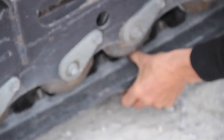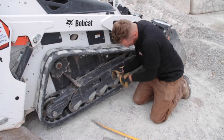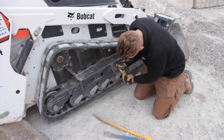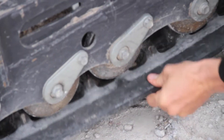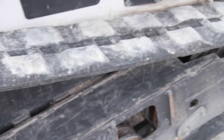So I take my thumb — I'm still a little loose, probably a couple more cranks. I'm going to go a couple more. About right there. See my thumb? I still have that sway; we still have a little bit of play. If you tighten it too much, you run the risk of — if there's any type of tear or rip or anything — the track will break in half or you'll stretch it too much and it will break.